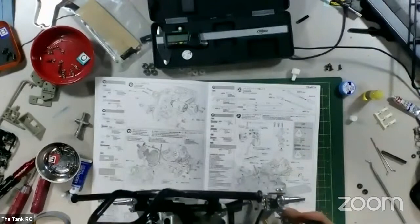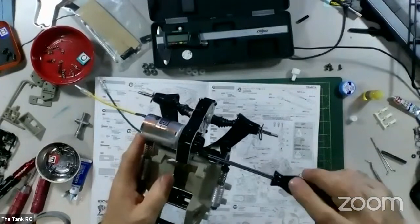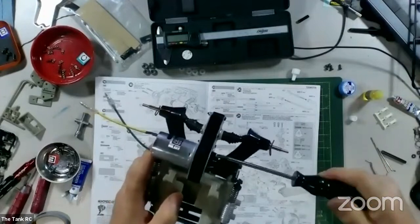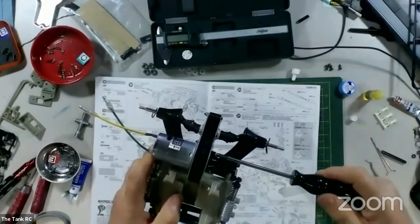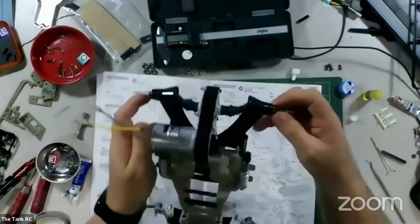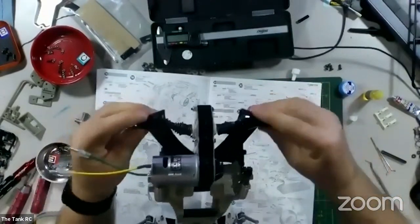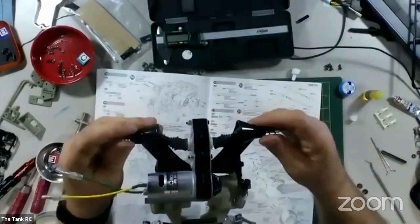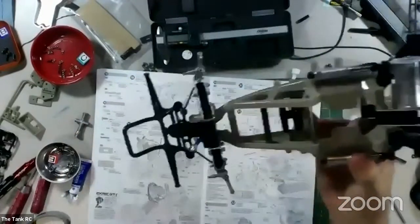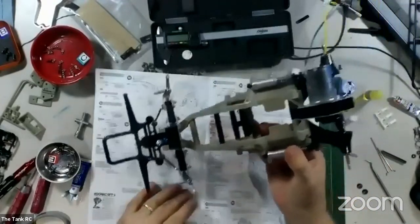You don't want it too light because you want your suspension to move slow so you can get over. If there's a hole between the rocks, you don't want that tire to drop down in the hole because it can flip you over. Oh, I was talking about for traction when you're running a buggy, which is faster going over ground. So I would think you'd need softer to get more traction. No, that's all in how you have your shocks and your suspension set up. Running flat is a lot different than running banked.